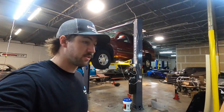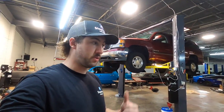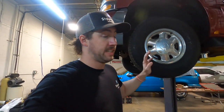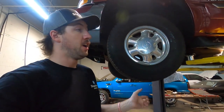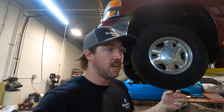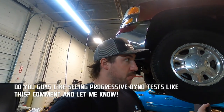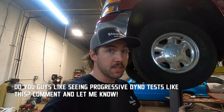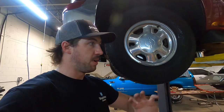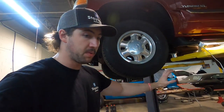In the last video, we just had Uncle Rob on the dyno for the very first time with the 4080 conversion that we just finished up. Pretty good power, but not good enough. I won't ruin the number for you. It's fun, it's very fun to drive. But we did it with the stock fuel pump just to see how much power you could make reliably with the stock fuel pump — not in danger of leaning out. Pump gas, 93, stock fuel pump with boost. Just put some injectors in and go. That's what we were testing. The test was successful.